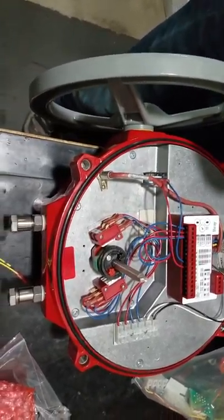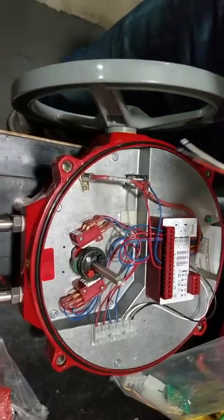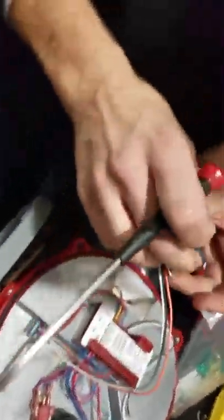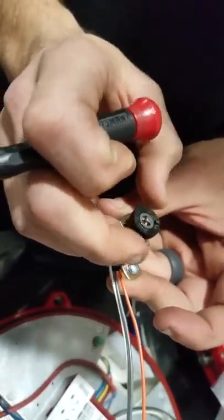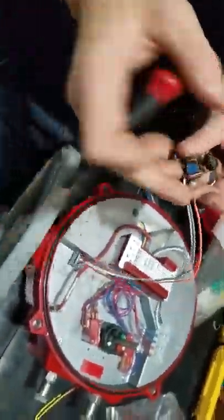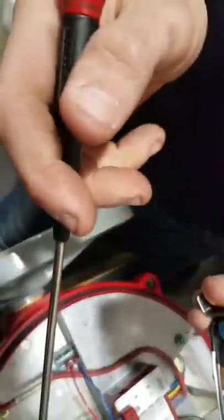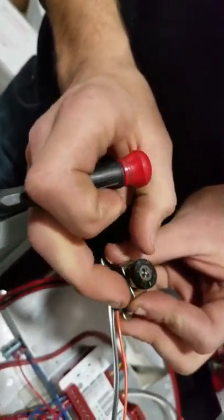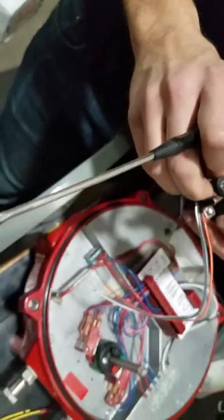Okay. Next we're gonna take our potentiometer and make sure. It's still going, huh? Oh yeah. Quite a few things more. The potentiometer rotates basically 360, but a little less than, so it cannot go past a certain amount of turn before it'll destroy itself. If it goes past that, it will break and then you'll have to get another one. Before I mount it, I make sure I turn it all the way counterclockwise with the wires facing away from me. Okay, so all the way counterclockwise? Yep, you'll feel it stop. Okay. Wires away from me.